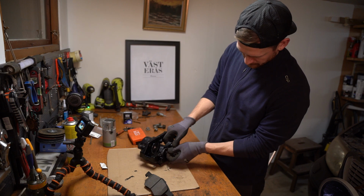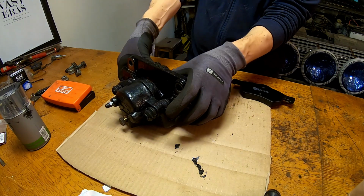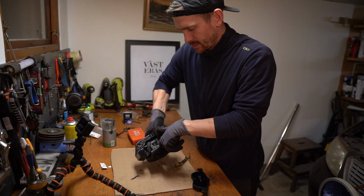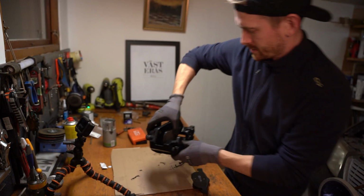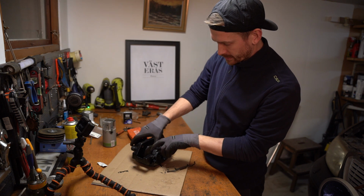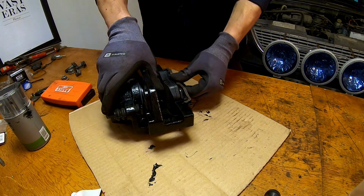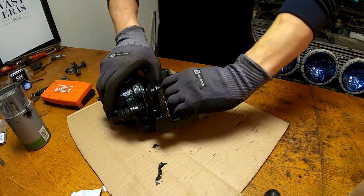So here you put the inside pad in first. Just lift the caliper frame up a bit so it sneaks under there. So you see that the brake pad is under the caliper frame. And then you place the other brake pad in the right place. You put this on the top first, here and here. And then you press it down in the middle to fit in the two holes. And then press it in so it's locked and secured.